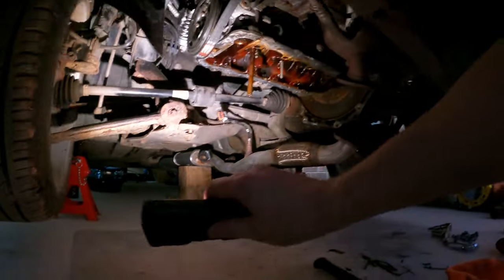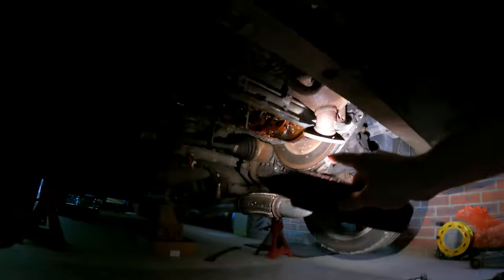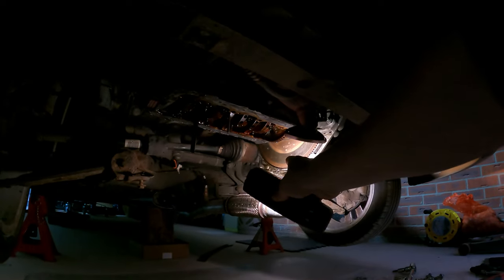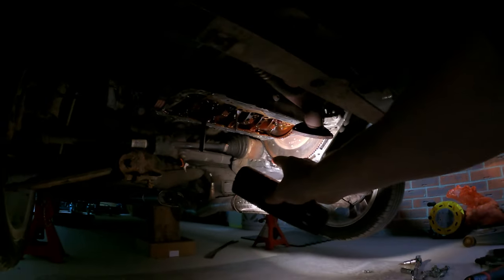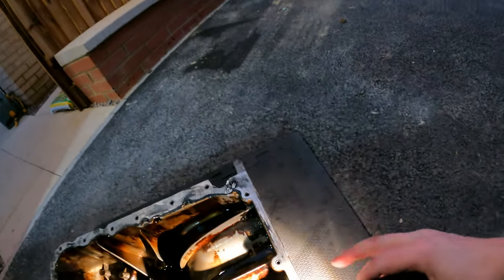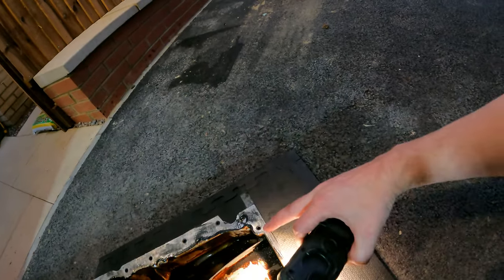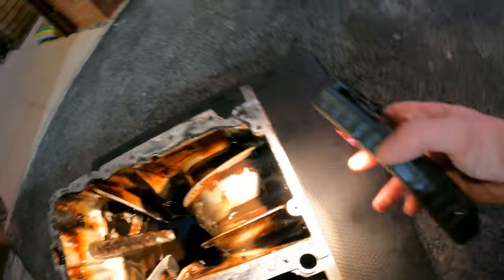Under the two brackets in the center just down there - and drop down and come out. Good news is it's not the crank seal, which was a slight concern, because there's no oil pooling at the bottom of the flywheel. So we know it was literally just the sump gasket. I think I know why it failed - on this area here I think it got nicked slightly when it was put back into place, which left a gap and that was allowing oil to accumulate down here.